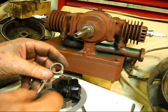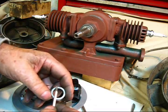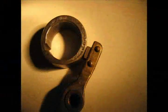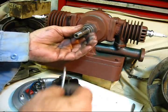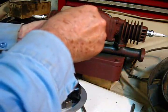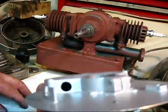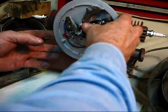To install the timing cam, the ignition cam — there's a part number on there and an arrow right there. You want that arrow to always be facing you. There's nothing on the back side but the arrow facing you. The key has a taper end that goes to the bottom; you put that right on there. That's all there is to putting the cam on. The backing plate alignment notch goes to the bottom — put that on there and it latches in the hole down there.